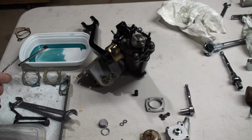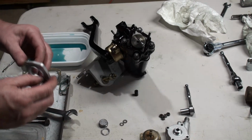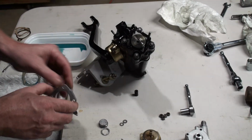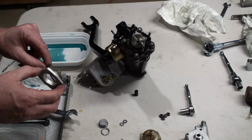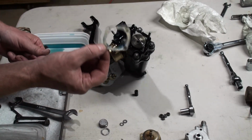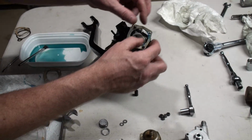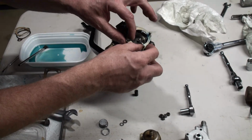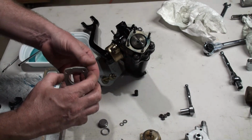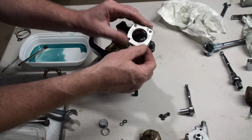Now we're ready for a gasket. I just want to verify, I mean the gasket with the large hole. Okay. So now the blue stuff on these is Hylamar, not to be confused with the blue oil that I'm using for the lubricant assembling. So we get our gasket in place. We put our aluminum spacer in, flange down.